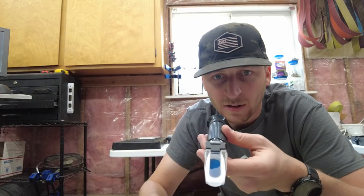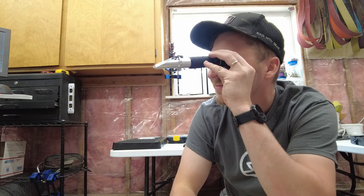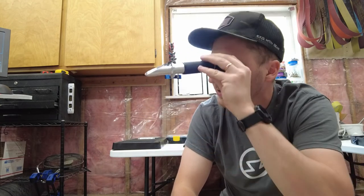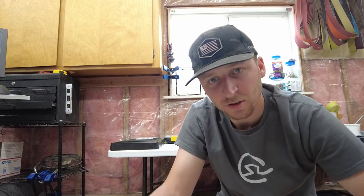I'm going to see if you can see it on camera. You can see the blue and the white and you can see the percentage. It may not have looked very good on camera, but I can see it crystal clear. We're at 6% — that's dead on because I thought I was going to need about three and a half or four cups. I put three in, we're at 6%. I'm going to put one more in and then I'm going to dump this thing in the machine and see what level we got and see if that thing is still leaking. Hopefully not.